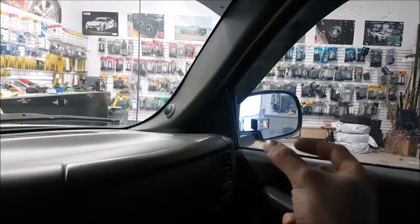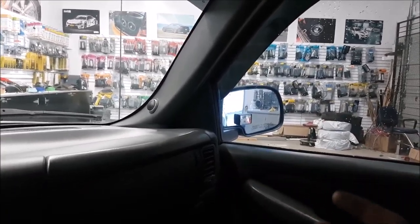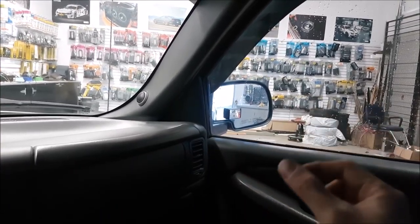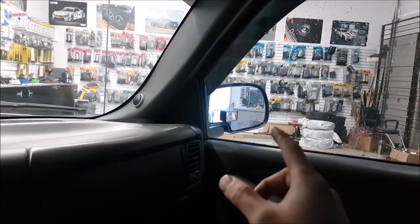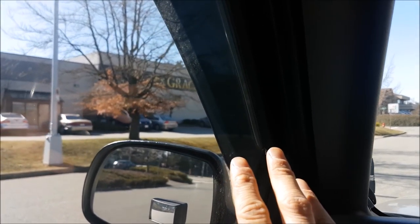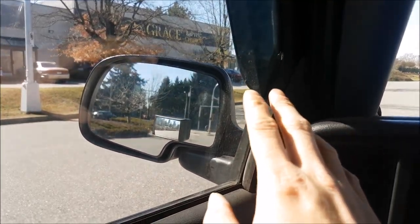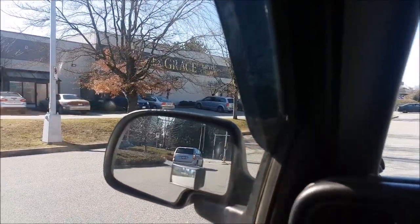You might notice I put my convex mirror closer to the truck. Most people put them on the outside — the reason is I don't really tow with this truck. If I did tow, I'd want the convex on the outside to see beyond the trailer. I put it there just to immediately see my blind spot. These smaller ones are also translucent, so you can still kind of see through them, though at night they may obstruct your view of pedestrians a bit.